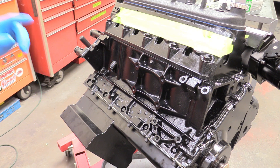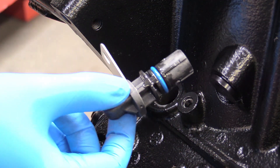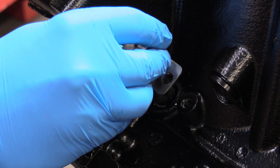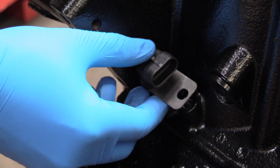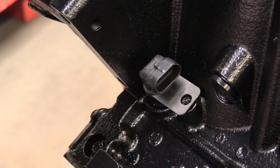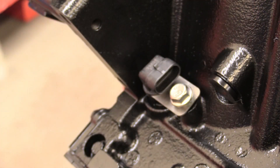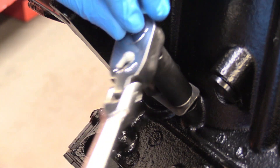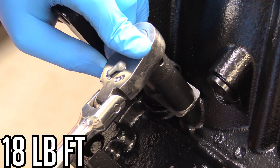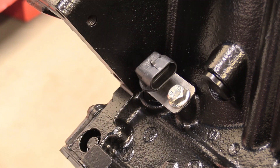Now I'm on the passenger side of the engine, and where we're going to be working to put our crankshaft positioning sensor in is right here. I have some oil — a nice film on my O-ring. We can go ahead and replace that and just be really ginger with it, be gentle. We can replace our bolt, grab our 13 millimeter socket, and just snug that up. This doesn't need to be crazy tight — just snug. All it's doing is holding a sensor in place.